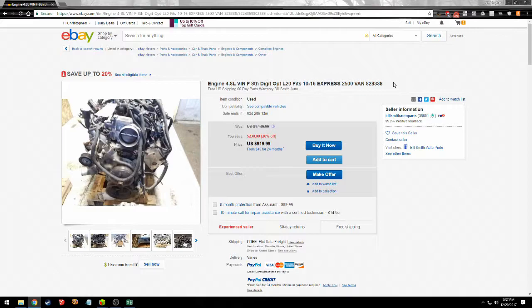Essentially, what I'm thinking is to try to get one of these little modern L20s or something. They've got a little bit better rod than some of the earlier LR4s. Then all we have to do is put in a decent little cam and maybe some different valve springs, and we should be able to comfortably rev her out to 7,000 if we need to. So that'll make it a lot easier to find the correct power band that we have to worry about.